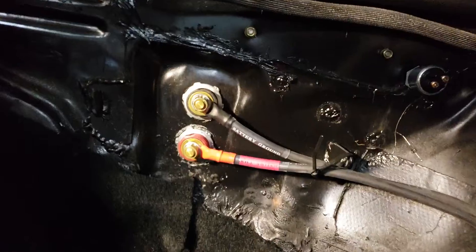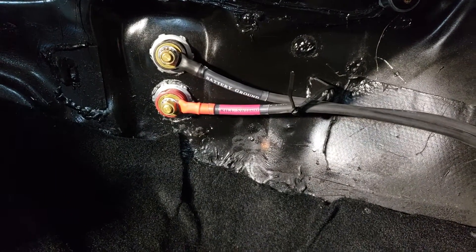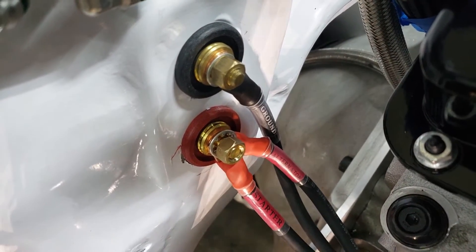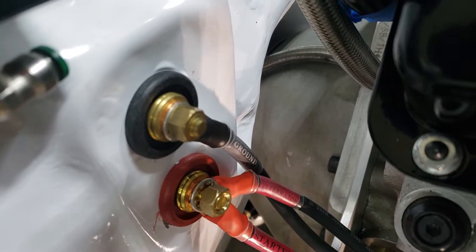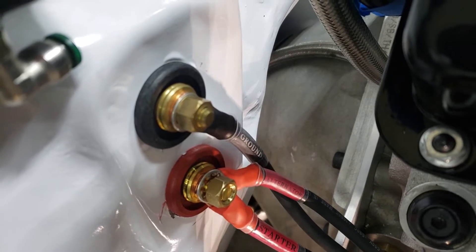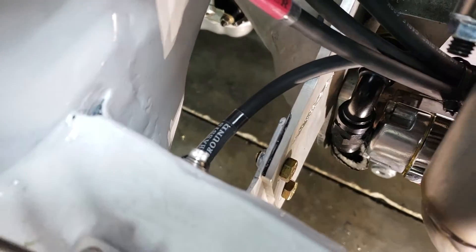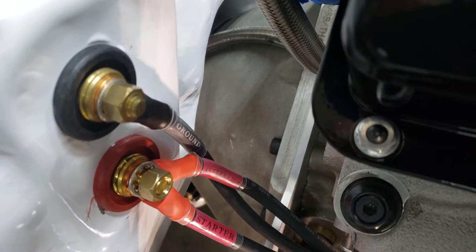I use these little firewall bulkheads — I think they call them feed-through bushings. They give you a little post up underneath the hood. If you look, we've got one wire on there labeled engine ground, and that goes down to the block. Now, if we look here, there is another one of those nutserts — that is a chassis ground for the block. So we've grounded the battery in the back to the chassis, then ran a wire from the battery up to here, and from that feed-through we ran straight to the block.